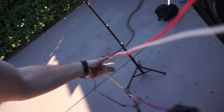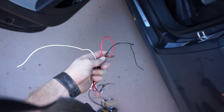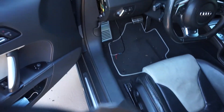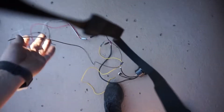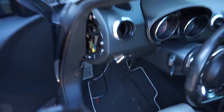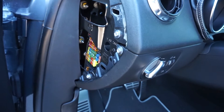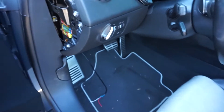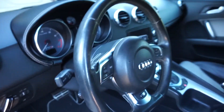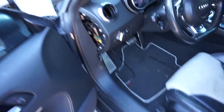On this gauge it has three wires going to the sensor — red, black, and white — and then it has a red wire for power and a black for ground. That's all you've got to do. For the power, I'm going to wire it up to the tire pressure monitoring system fuse, because it wants a 5-amp fuse, and even if it blows that fuse it doesn't matter because I have TPMS disabled anyway — this car was a bit funky when I got it.